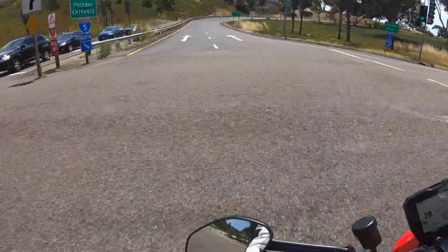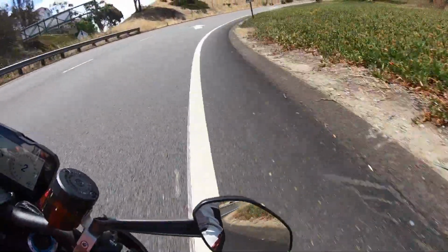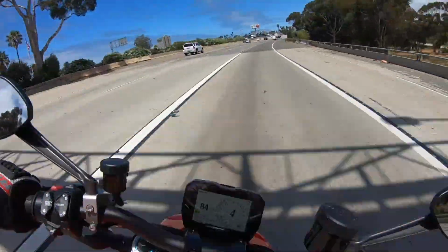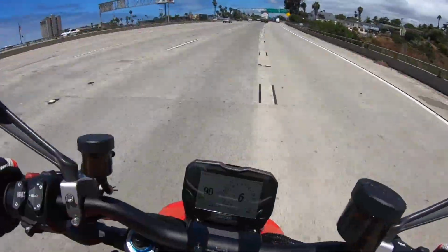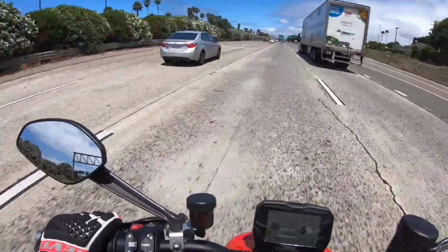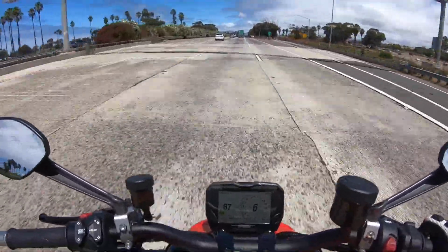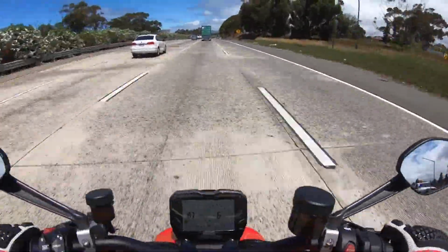Alright guys, we talked about the handling, we rode this thing in the canyons, and God, this thing handles great. We're riding on Pirelli's Diablo Rosso Corsa 2 tires. This is a high performance tire from Pirelli, and it's awesome. These tires work really good. They have good feel, good grip. The profile of the tire isn't crazy aggressive, which actually works really well because the handling of this motorcycle is a little bit aggressive. So to have a more neutral tire profile complements the chassis well and helps it from being too crazy aggressive to ride.